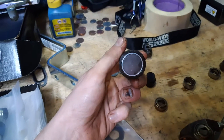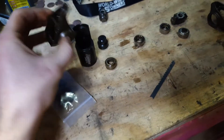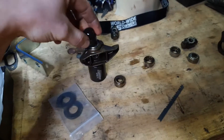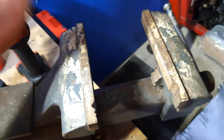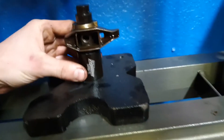It's got a magnet on the other end so it helps keep it where you want it. You take the factory rocker arm and trunnion and stick it in that way, then take this little die, this little press. You could do this in a c-clamp - wouldn't be very fun but you could do it. A bench vice would be another viable option and would work pretty good, but unfortunately this vice is trying to pull up on the bench, so that's not going to work very well. So today we're going to do it on the fun toy - the press.